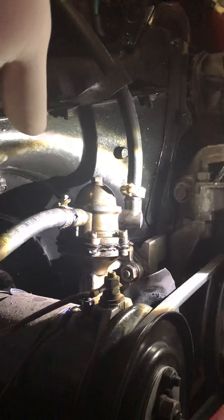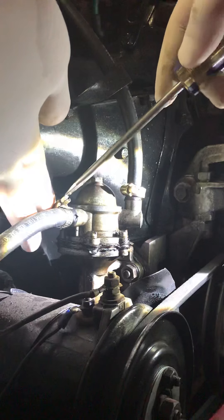The first step is the pipe running from the filter to the pump. Just loosen that screw as much as you can — I've already pre-loosened it so it should come off pretty easily. Be aware you will get fuel coming out, so you'll want something to block it with, either a screwdriver or a bolt that should fit inside the connector.